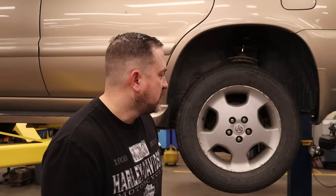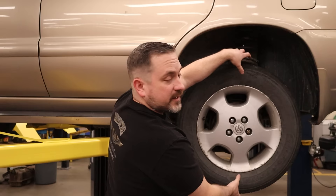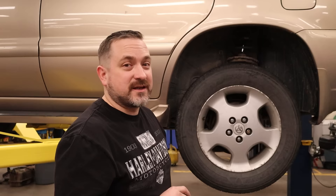With the vehicle up off the ground, you're gonna grab the left and right hand side of the wheel and give it a little shake. If there's any play or any kind of clunkiness, that's one step further towards it being a bad wheel bearing. However, if there's play like that, you also need to check from the top and the bottom — give it a little rock in and out. If there's play there it's pretty much guaranteed a bad wheel bearing, or the only other thing it could be is loose wheel lug nuts, so check those first.